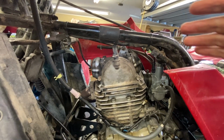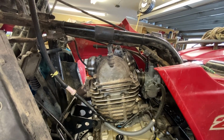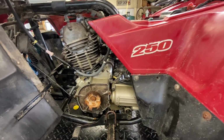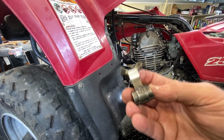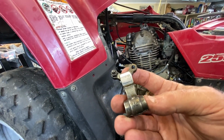it's hard to describe. I shot a little bit of video. I'll insert it here as I talk, but they're mainly B-roll video. I'll show you on a rocker arm that I have laying in here. I happen to see one in one of these bins here. Okay, I'll show you on a rocker. This is actually a Magna rocker with a VF750, because it's got the single rocker with the two stem and nuts to adjust the two valves.